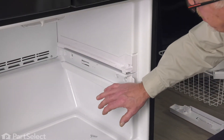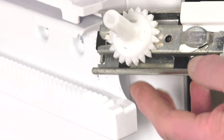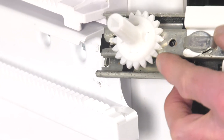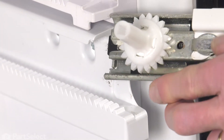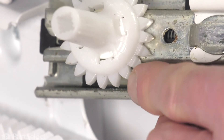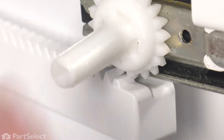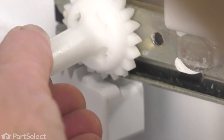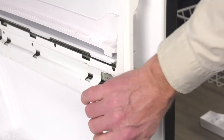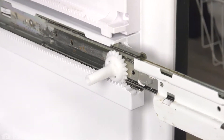Now we're ready to put the complete track assembly back in place. When installing that rail assembly back into the freezer, we want to make sure that that drive wheel is in the right position. There are two flat spots on the gears of that drive wheel — we want to make sure the very first tooth that is cut starts out in that first slot. Line up the track and rotate that gear so that the first tooth fits into that first notch. Make sure we push it all the way back in until that track locks into place. Then just check the alignment of those gears.